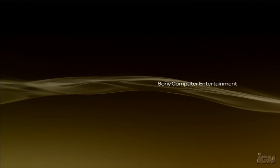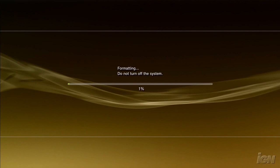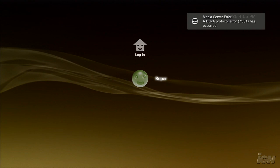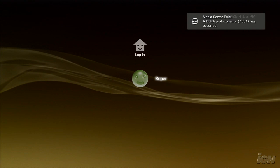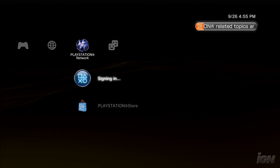Now we can plug the PS3 back in. If you don't have a backup drive, you'll get to see how the system still works. First it'll say hard drive must be formatted — it'll erase everything, but it's brand new so there's nothing on it, so pick yes. This goes pretty fast, only takes a few seconds. Then the system restarts. So we're back up and running. And as you can see, even though I haven't backed anything up yet, all my users are still on here. My PlayStation ID is still saved onto the system so that automatically signs me in. My friends list is there.